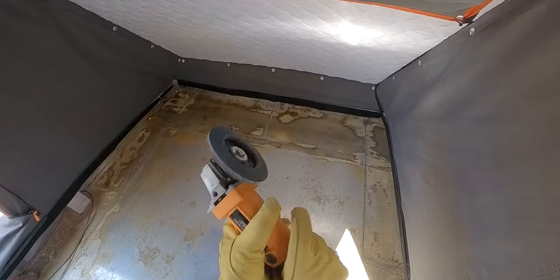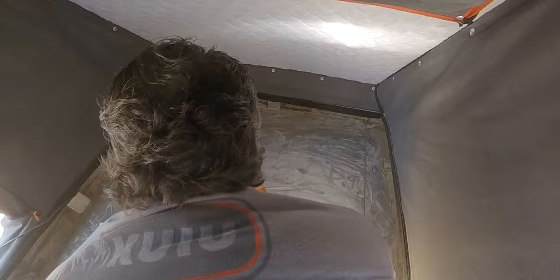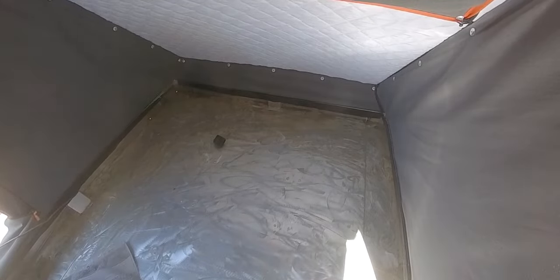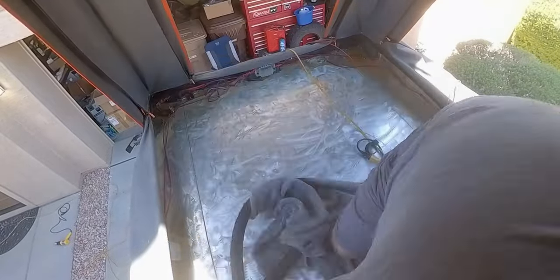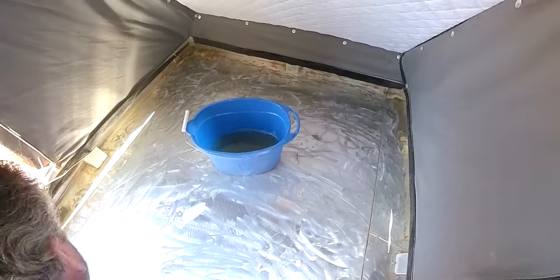I was really careful because of the thin aluminum floor, but I wanted to get that dried glue off — 120-grit flapper disc, one or two light passes, just kind of one-handed. It looks like a horrible pattern but in person it was cleaning it perfectly, though creating a ton of dust — I probably should have worn respiratory equipment but didn't. I just wanted to get as much of that stuff off, then vacuumed every bit I could out of the fabric. Followed up with the damp cloth wipe-down, a little soap, a little more disinfectant with terry towel, wiping the whole tub out.